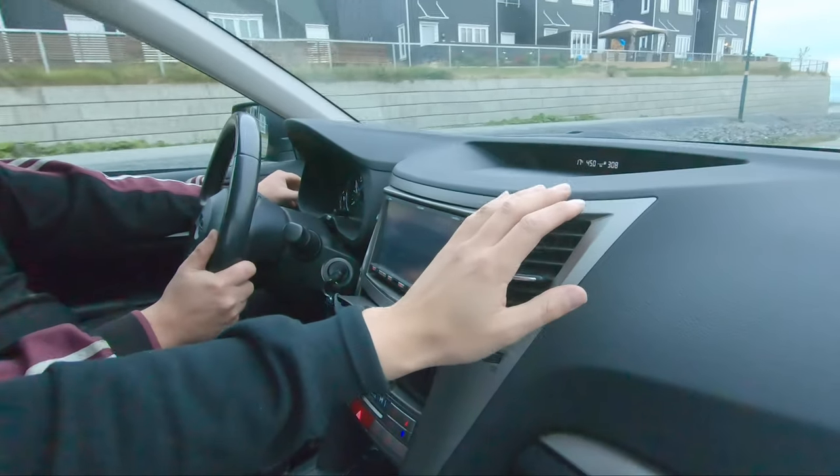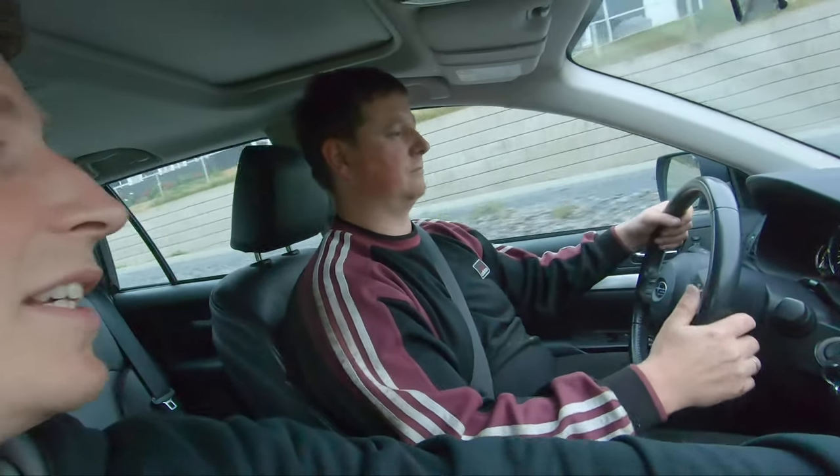So we're gonna go back now and check the reservoir, fill up more coolant if we have to, and then probably go one more trip up to the small hill that we were on, because it seems like that got the air out of the system, because now it's super warm and my brother is feeling happy inside. We were a bit afraid that maybe the water pump was dead, but it's definitely working because I'm starting to sweat.